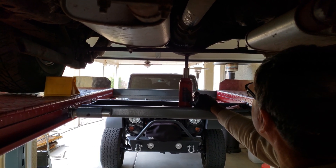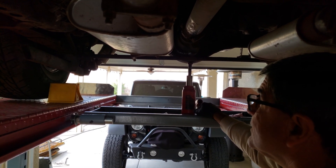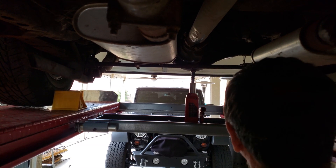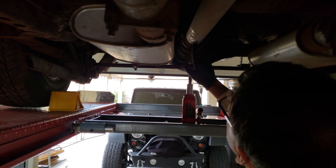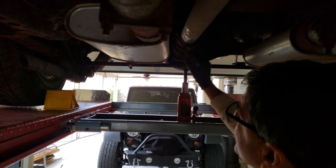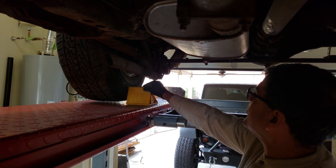I see a lot of guys asking how do I tell what gear ratio I have in my differential? And it's very easy. You just have to get both tires off the pavement and spinning freely. Mark your drive shaft — I've got a piece of black tape here marking our starting zero point, and this is right at the tip of the arrow right before the K.